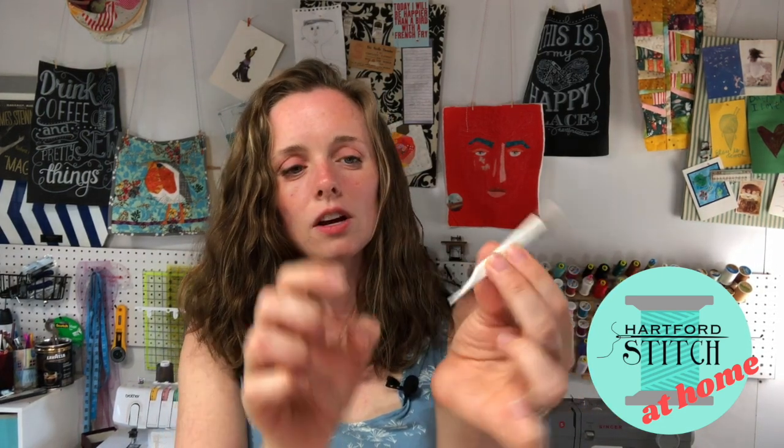You also want to have a little brush. If your machine is new you'll probably find one in the little extra accessories tool kit that comes with your machine — it's just like a short little bristle brush. Sometimes they have the seam ripper attached to it on the newer ones. If you've lost yours you can always find another one at walwack.com. If you don't have one and desperately need to clean your machine, a good Q-tip will work as well. Just make sure it's not one where the lint comes off a lot because that'll just cause more problems.